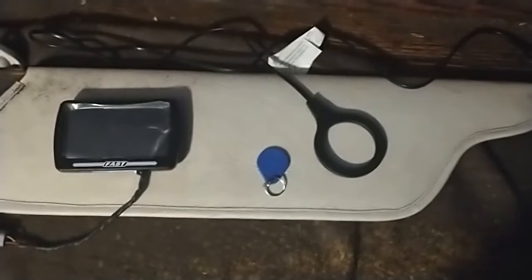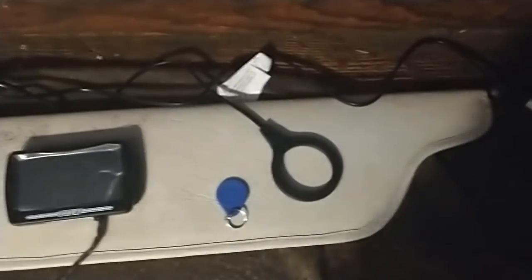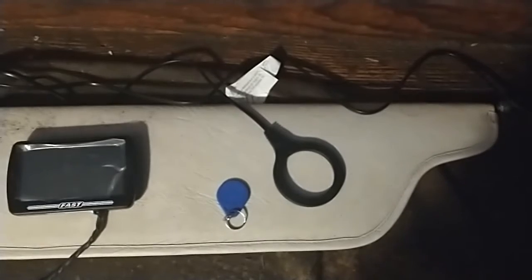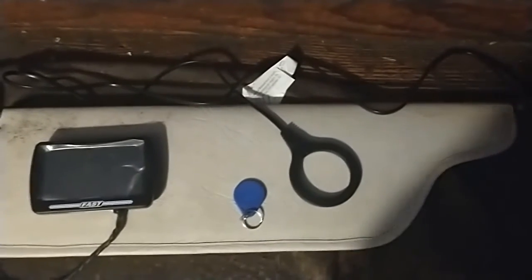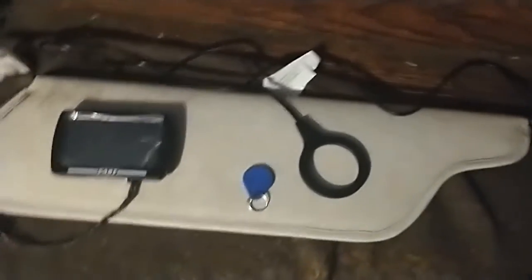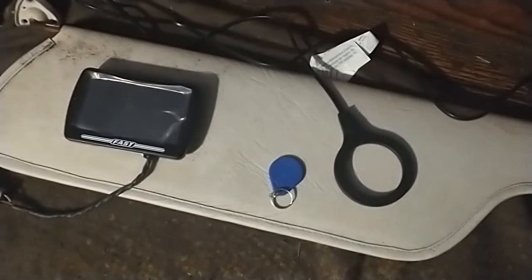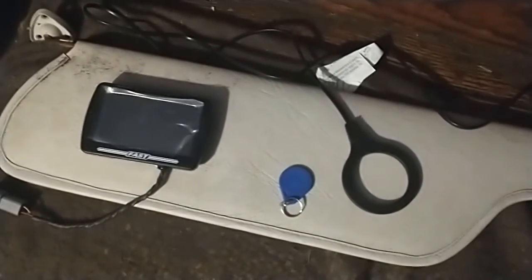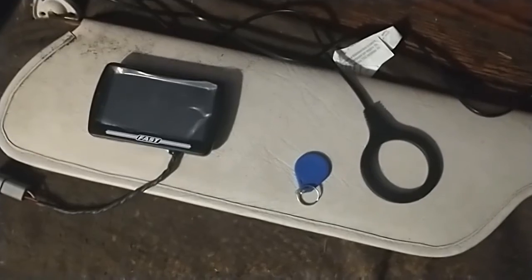That RFID chip has to be within two feet of that proximity sensor. The other dilemma is where to put that sensor — I can't put it directly on metal, so I can't really put it in the dash. The car has a bench seat, so there's no center console to hide it underneath and throw your key ring on top of it. So I got to thinking: besides this little blue RFID chip, he'll have the key fob for the security system which will unlock the doors. Why not incorporate this ring inside the sun visor underneath the fabric so you wouldn't even see it?